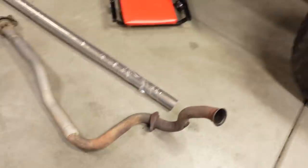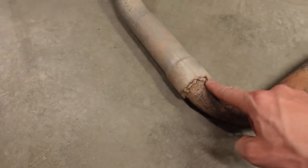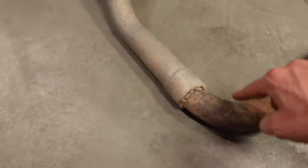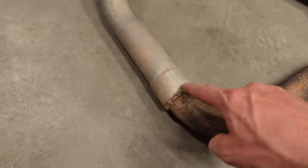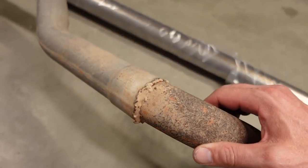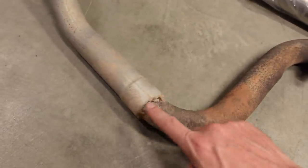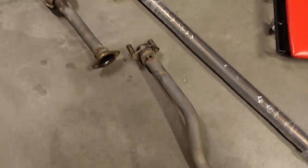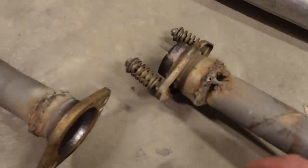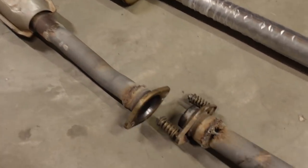So a little bit further back in the exhaust system, this is the kind of stuff that just drives me crazy. We've got a MIG welded joint between this, I think, factory section and this middle pipe here. We'll get to that weld in a second. But they have slip couplings, which I hate using, and then it's just kind of booger welded together. I mean, more than likely this was just installed in the truck, so it's very difficult to get the top side of these joints, but that's just sloppy work, and to me, there's no excuse for that. A little bit further back, things get even worse, so they had to add this little coupler in here to make the exhaust system serviceable so you can disconnect it.